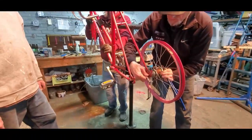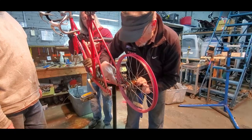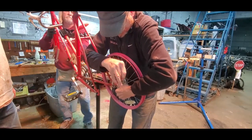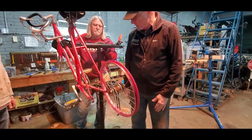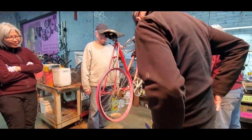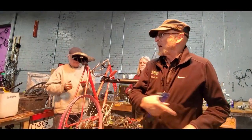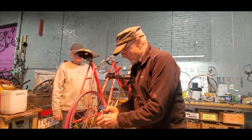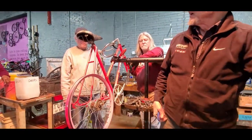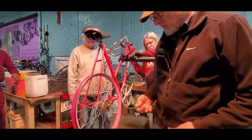I'm going to put it on your side. Fold it onto the frame. Now, I can't accidentally take it apart on the wrong side because it's folded there. If you ever notice in diagrams in books, they'll have a little dotted line as the pieces come off. Take off the outside nut, and that dotted line — lay a white piece of paper down and put it there. Then the next one comes out and lays there. Everything gets closer when you want to go back together. Use the tool tray so you won't trip over it.